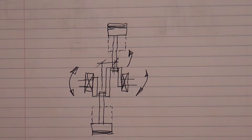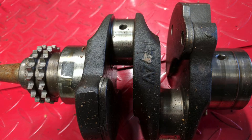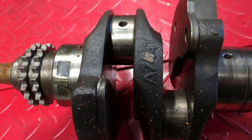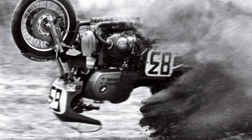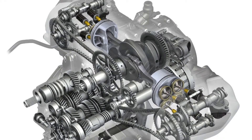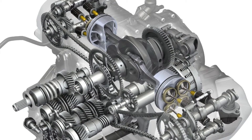With this engine arrangement, as with the 360-degree parallel twin, both pistons go up towards top dead center simultaneously, so pumping losses are relatively high and crankcase breathing needs to be managed well. The picture here shows an R100 BMW crankshaft. As with all motorcycles with the crankshaft running longitudinally, you do get some gyroscopic or torque reaction effects — not a vibration, but a reaction from the rotating parts accelerating or decelerating. It's generally disconcerting to people that aren't used to it, but once you are, you don't even think about it. Modern iterations use counter-rotating shafts to negate the torque reaction and balance shafts to counter the rocking couple.